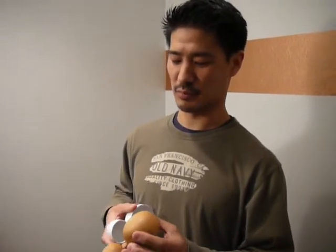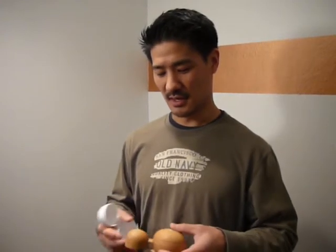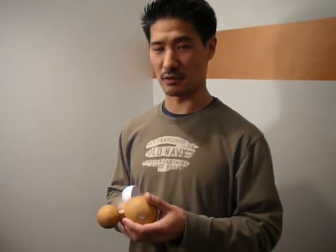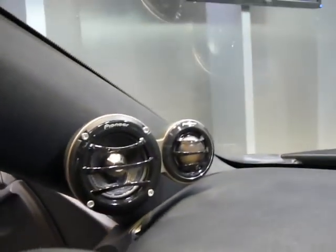The pucks, after I finished sanding them, were resined, and what that does is it allows you to pull the molds off of it without the MDF separating. So I resined the piece just to get a little bit extra strength, and then sanded it smooth with probably 220 grit sandpaper. And then I made a little bridge between the two, because if you notice, there's no wires visible on the pod, and so what that does is gives the tweeter wire passage.